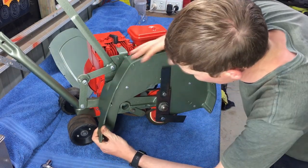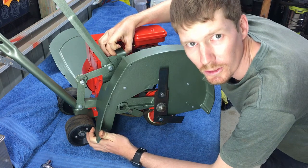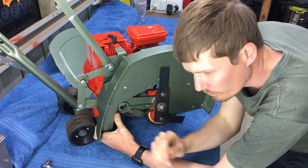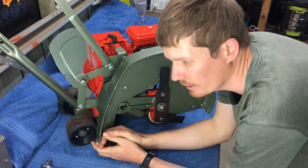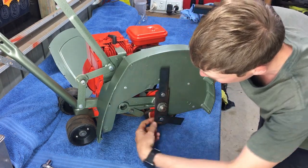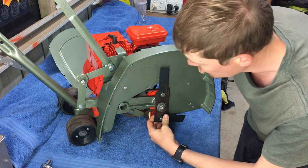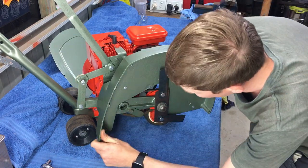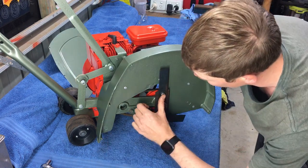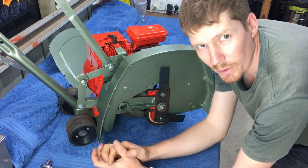Okay, so we've got the cowl mounted on the machine. The bolts are in a difficult spot, so it takes a lot of slow movements, I suppose. Anyway, we've got that up there. One thing that has presented a problem, and it's quite a simple fix. Basically, I've mounted this blade the wrong way. So on the rear of the blade holder, we've got the nylock nut, and that's actually hitting the cowl. So that's a simple fix. Just gonna have to undo this nut, turn that around, and bolt it back on, and then we should have clearance and it won't be an issue. So I probably won't film that, but I'll do that off camera,